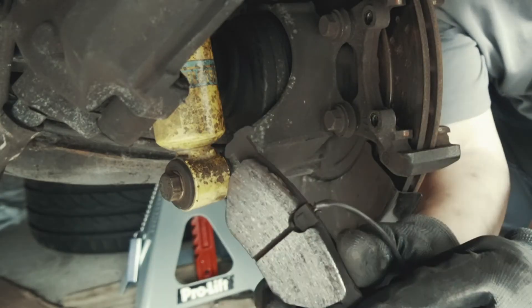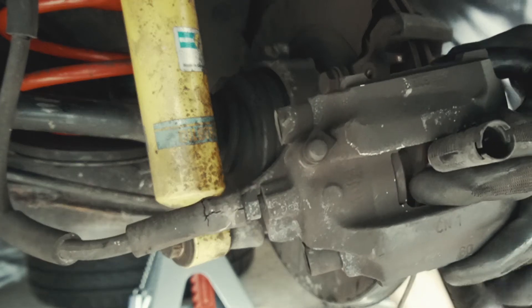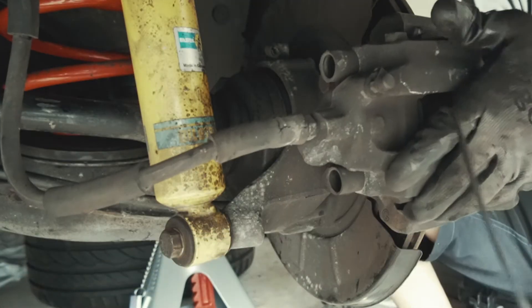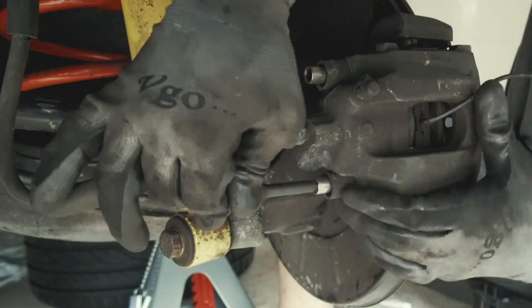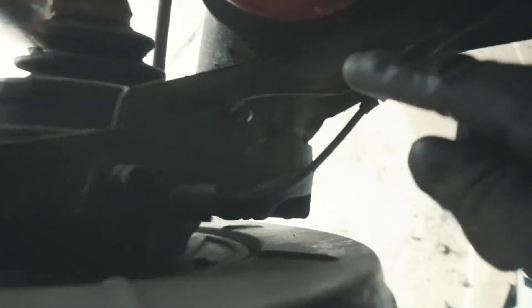On the right side there is this brake pad sensor right here. It feeds into the brake pad so we have to feed the sensor through the caliper. There are these clips that go into the piston of the caliper right here. If the piston is too compressed then use a C-clamp or something to push that piston back in. Then start feeding — feed it through this rubber cap through the brake lead. Feed it through one, two, three, four, five.